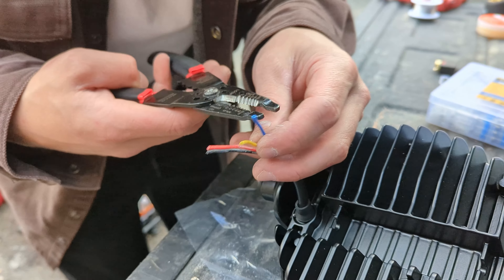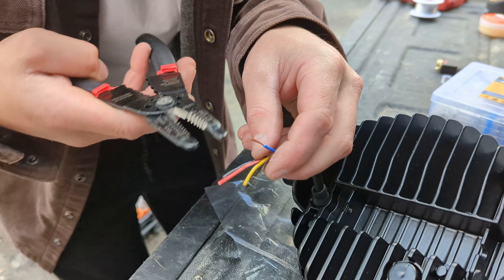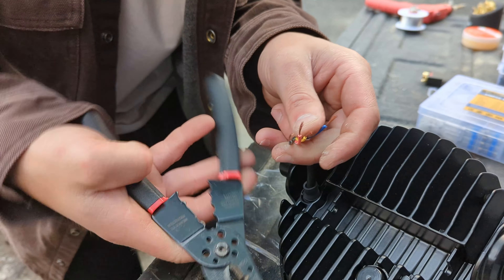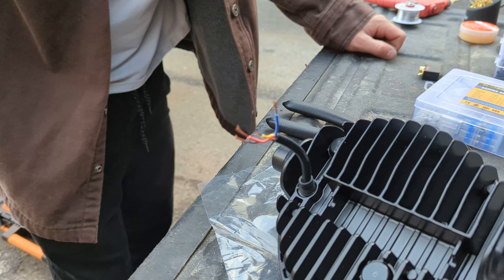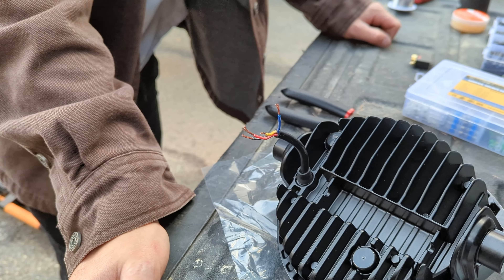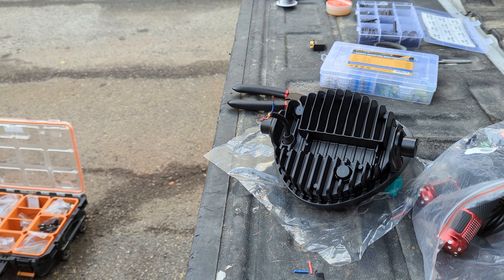It's four wires, not as many as I thought. These are going to get spliced with those solder shrink wrap connectors that I like to use. I'm going to get some wire and make it quite a bit longer so it can reach where the plug is for the headlight on the wire harness, since we routed pretty much the whole wire harness into the panel casing.